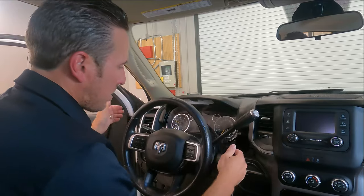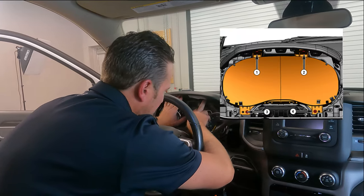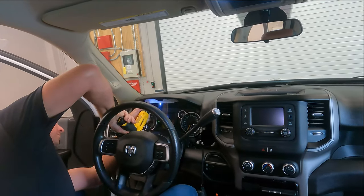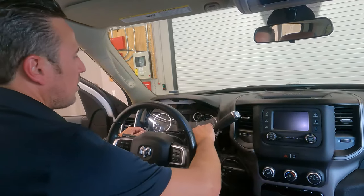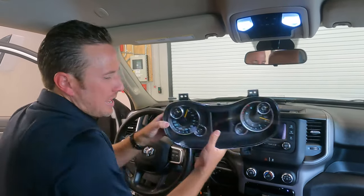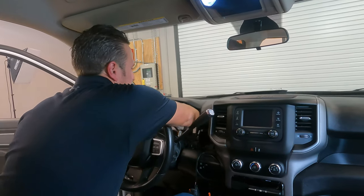Put the column down a little bit, then pop this panel out. You'll notice two lower screws on the actual speedometer itself and two screws at the top — remove those four. Now that all screws are out, simply pull the cluster out, flip it upside down, and temporarily disconnect it. Behind the speedometer cluster is where the security gateway module is located. We're going to disconnect those two connectors on the side of that module.